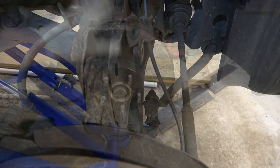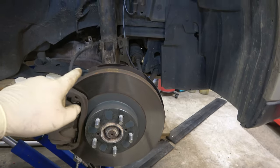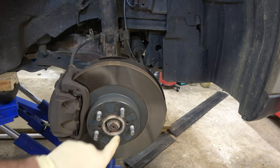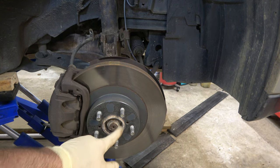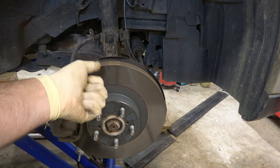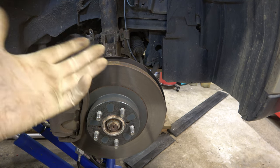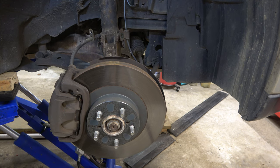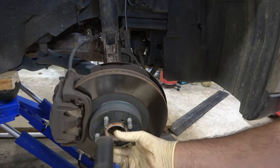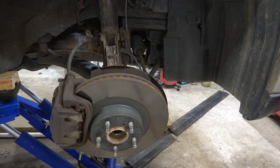Now this is important — their instructions don't say this is necessary, but they do point out that it's really easy to pull the inner CV joint apart inside the boot, which is a mess. So what I'm going to do is take this center CV axle bolt out and push the CV axle in, releasing the tension on it, because if this flops out it can pull the CV joint out. A lot of times you can put them back together, but it's such a hassle. I highly recommend you do that. That's a 32 millimeter that really did not want to come out, but the splines are not rusted in, so that's really good.